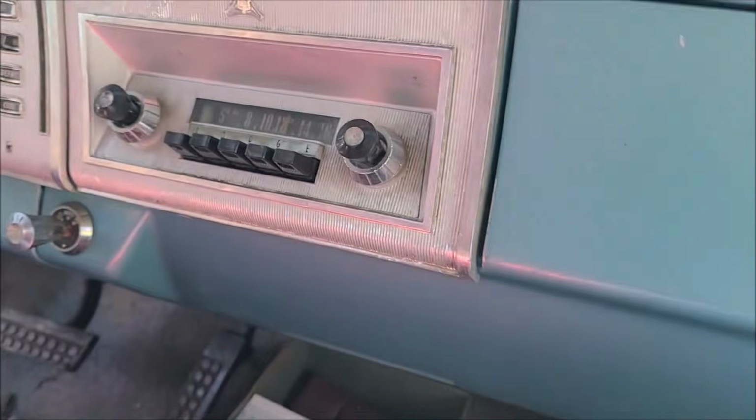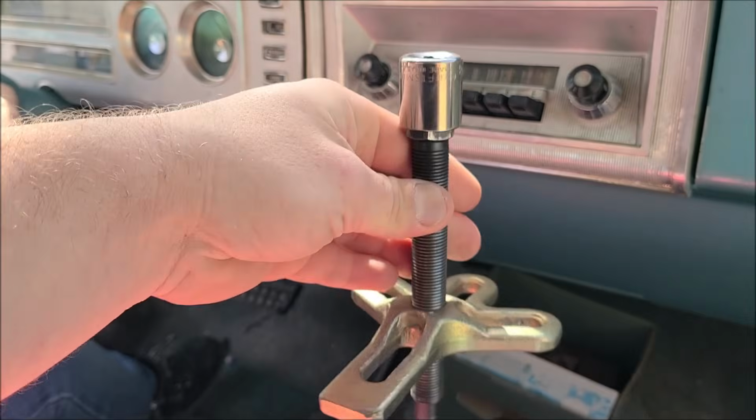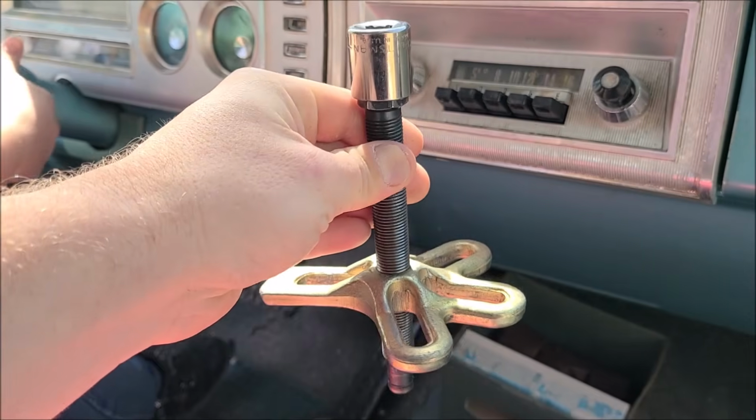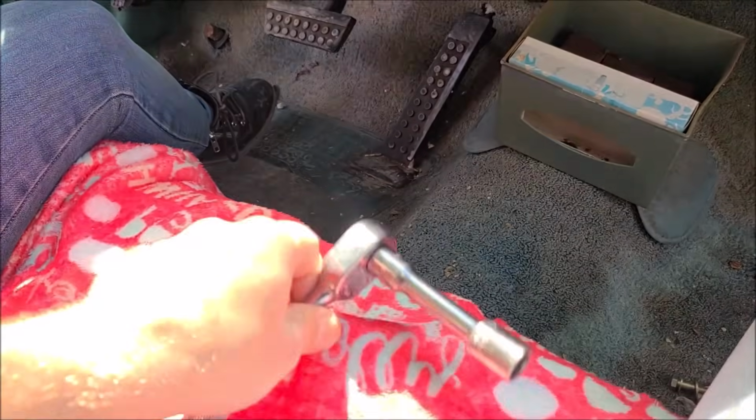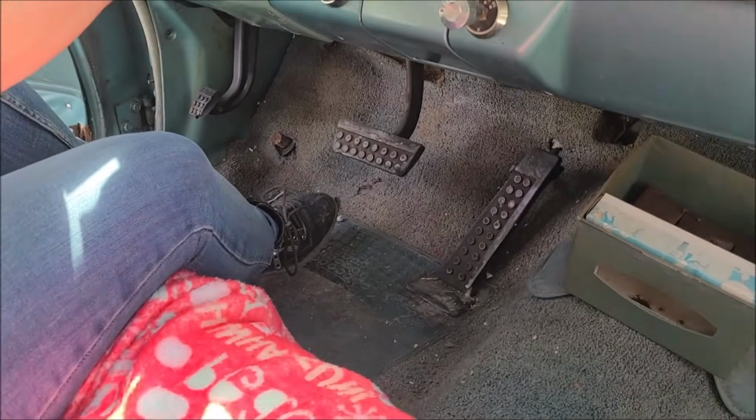Okay. So we are here now with Anna and Arlene, which I promised, so we're going to hand the camera over to Anna. But I'm just here to introduce us and show you a few things about removing a steering wheel on your car, which is pretty general stuff. So first thing you're going to need is some kind of pulley puller. We use this style. And you're going to need the bolts to use it. Extra 3/4 socket on the end. You need an impact or a ratchet if you're antiquated like I am.